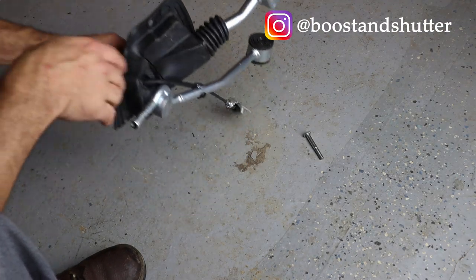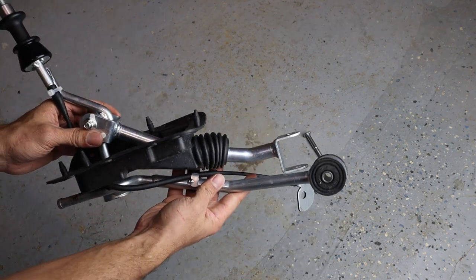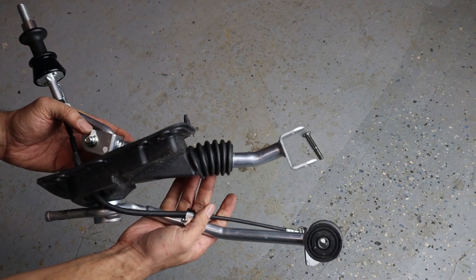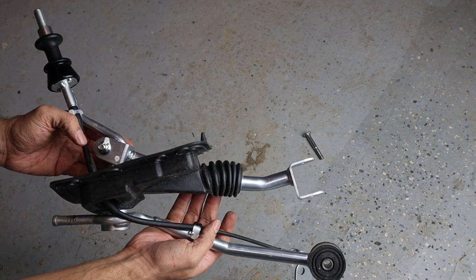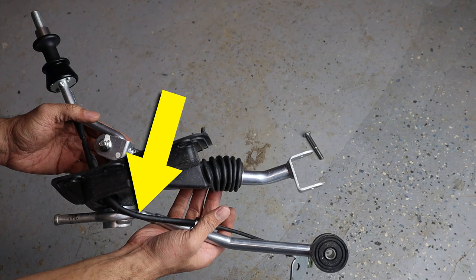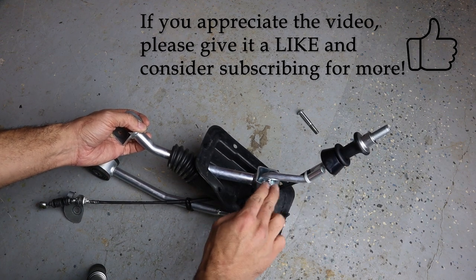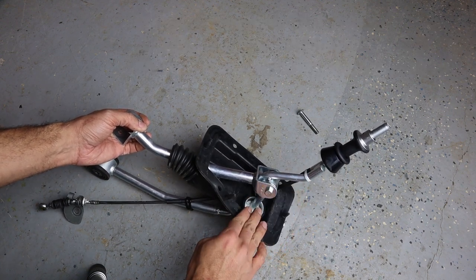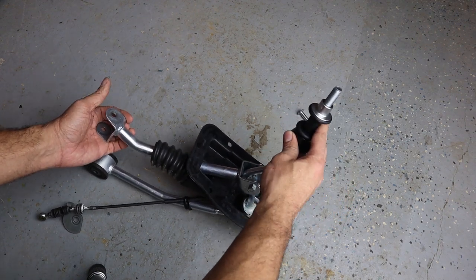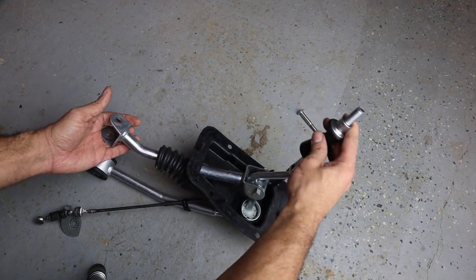This is what the complete shifter assembly looks like on the STI, but the general idea is very similar across different manual transmissions. This lower rod is known as the stay and it anchors the whole assembly to the car and absorbs vibrations. Attached to it you have the lever and then the rod connected to the lever. This cable is the reverse gear lock and that prevents you from putting the car in reverse accidentally. Where this pivot point is on the lever is going to affect how far the rod has to travel to change gears. The higher up the lever the pivot point is, the less travel that is necessary of the shifter — that's what ultimately makes your throw shorter.